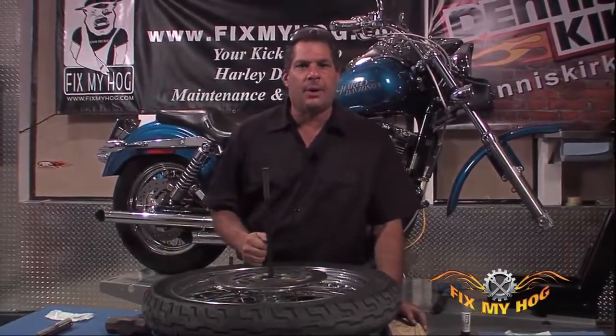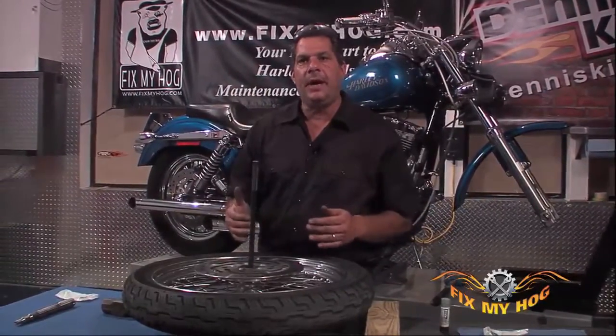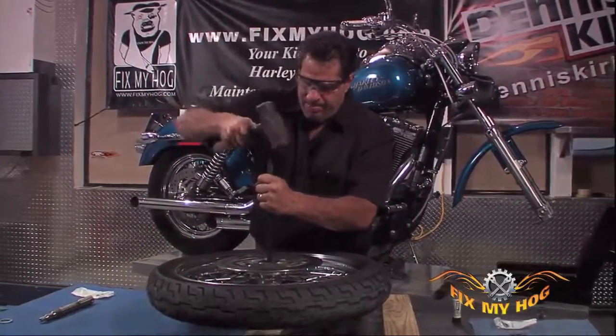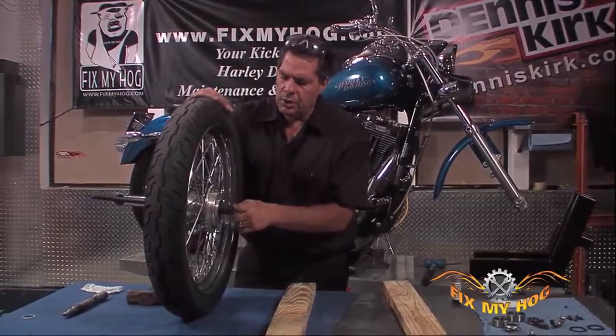You want to make definitive blows with the hammer. You want whatever effort you're applying to the removal tool to go directly to the bearing and shock it loose. I'll get the installer driven securely into the remover tool.